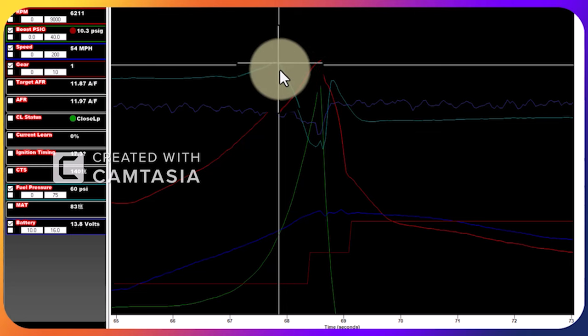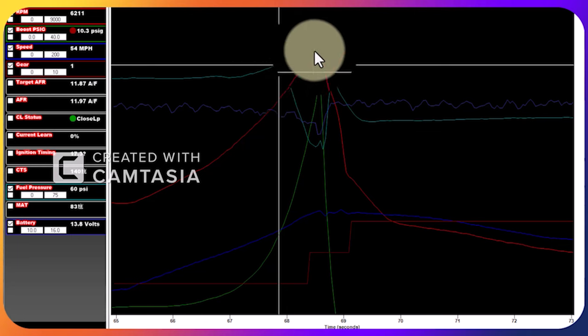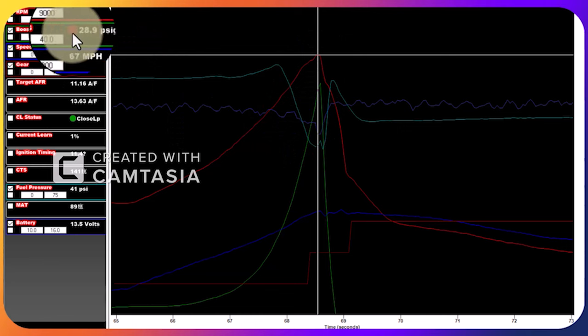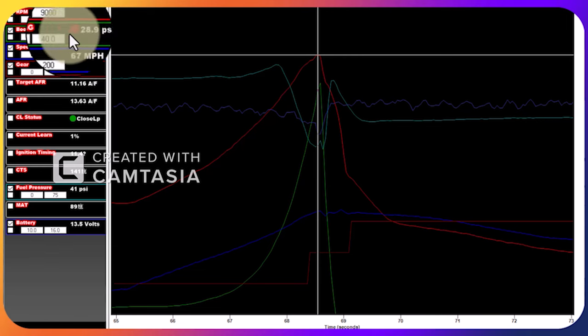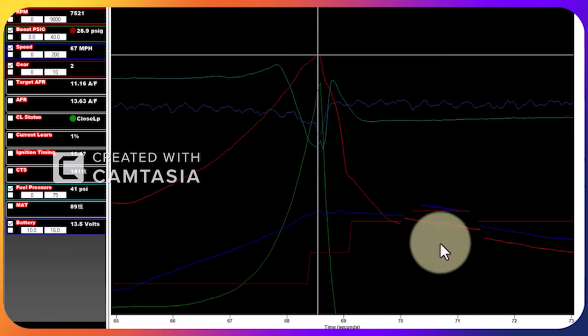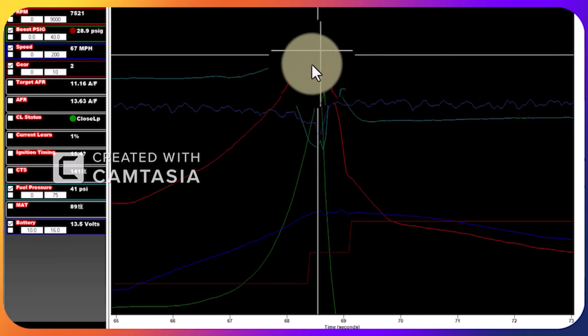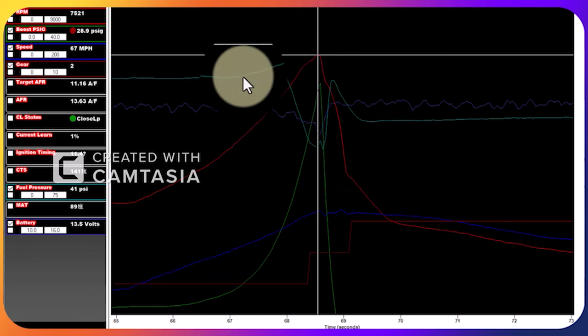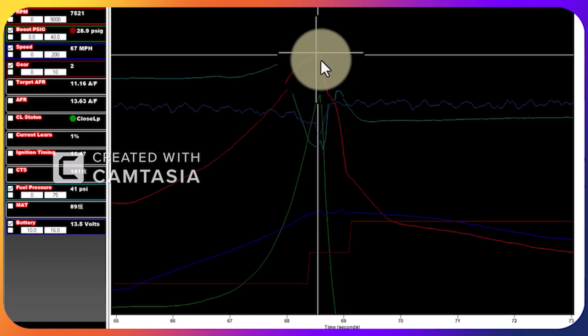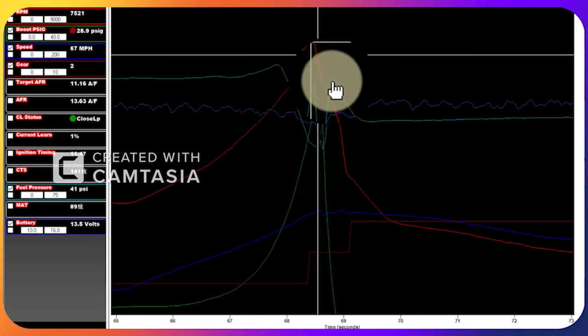The engine, out of one bank, needs to make 10. The other bank needs to make 10 for that 10 psi that you added. So in total, I needed to make 36 psi before the wastegates would start opening, and that's why we smashed into our boost safety, our boost cut, which is at 29 psi, and didn't get to make a full rip. Without that 10 pounds, we would have only seen around 16 to 18 psi from wastegate alone from the dual 8-pound springs. So that was going to be the next hit, but didn't get to make it because the fetter alley showed up.